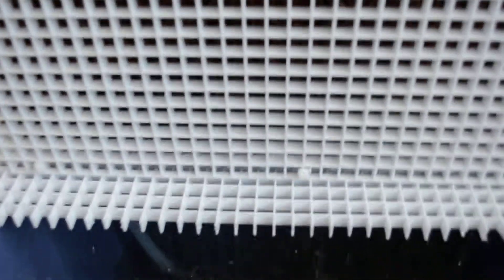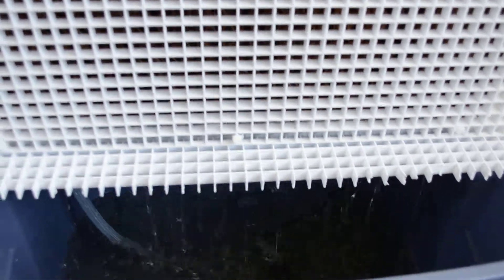Obviously it can't be actually in the water because it will electrocute you if you do that. And then inside you'll see there's just a little pump. The water should be dripping evenly across the bottom — that includes front and back, towards the front of the fan, towards the back of the fan, and left and right. This all has to be even. If you don't do that, the cardboard will not be efficient in its cooling.